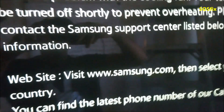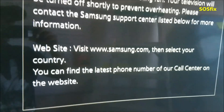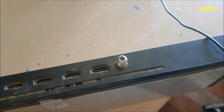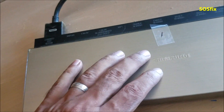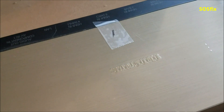The problem in this TV, as you can see here, there is an overheat problem. The cooling fan is not working right. So quick checking this control center — where the HDMI ports and all that — look how much dust. There is a fan inside this one, but the dust is making like a blanket, so there is no cool air going inside. That's why it's getting hot.